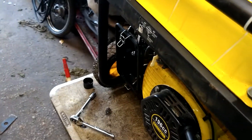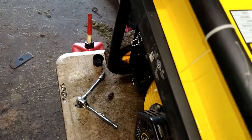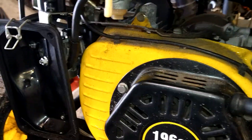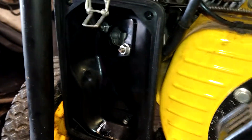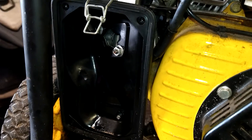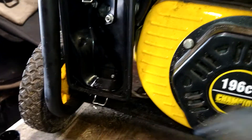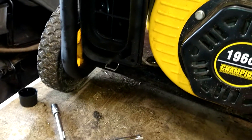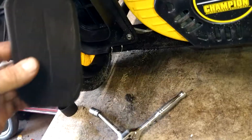We're going to go ahead and start this — turn that on. Perfect. Double check it to make sure it's not dripping anymore. I was just making sure the auto choke actually worked. Now put the air filter assembly back on with all four 8mm bolts — one at each corner. Air filter back in, and then this cover back on.